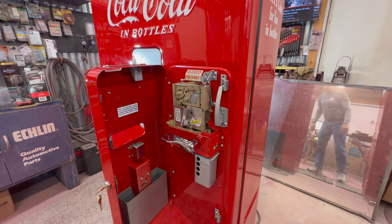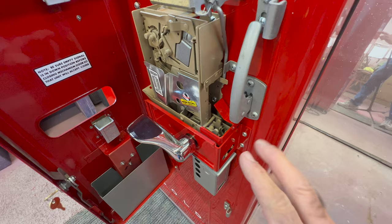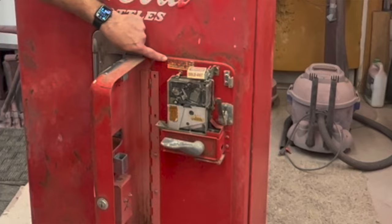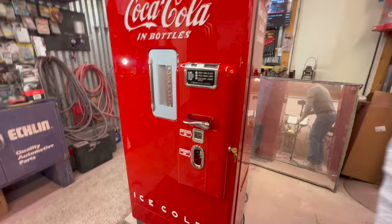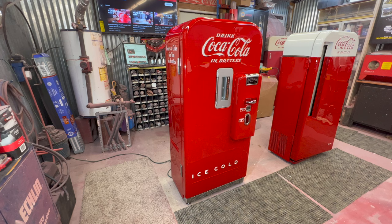On the coin mech, the early versions — there are two levers in here that you can adjust. If you run these two side screws in, this machine will turn into a free vend machine. As you see: 'sold out' and 'deposit coin, sold out' — that is the original. This one had one busted off; I found one from around 1953 that was in such good shape I left it alone, so people could appreciate it. This machine is 71 years old today — it's just incredible. Vendo made about 80,000 of these, and this machine hits right around the 30,000 group by the ID number.